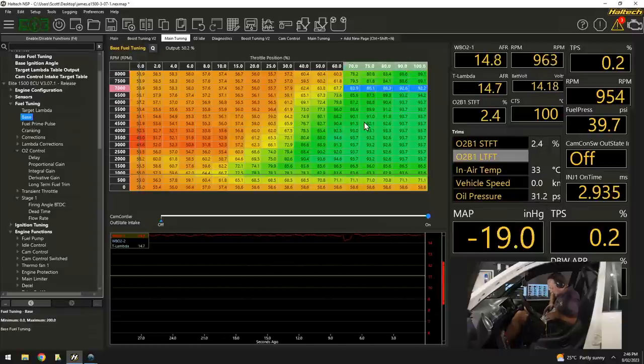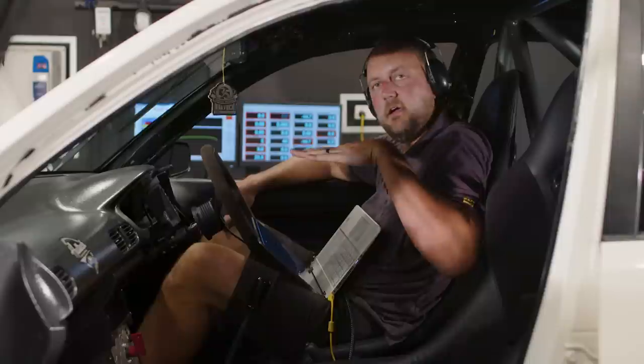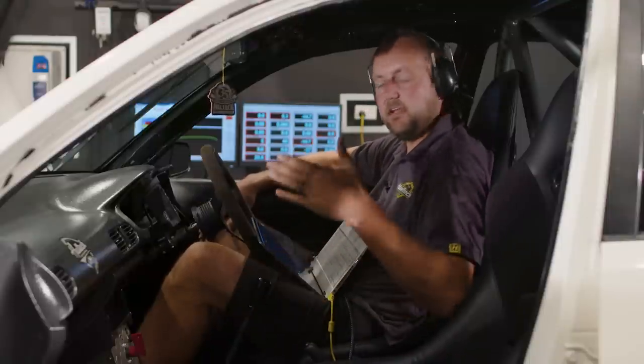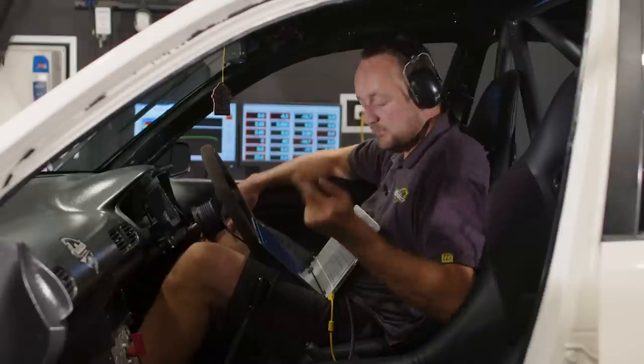We'll pull out 2 there. Up, 2. Okay. Now, we're going to come up to our 100% throttle. Actually, we'll go 98. The reason why I do 98 or 95 or 93, depending on the style of throttle bodies, is sometimes an electronic throttle can actually go over-centered, which will in turn reduce the airflow. These throttles at about 98% seem to be exactly open. If we go 100, it's the same as about 98% in the other direction.